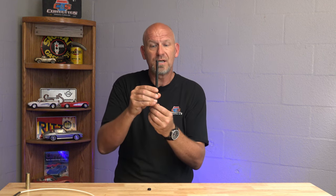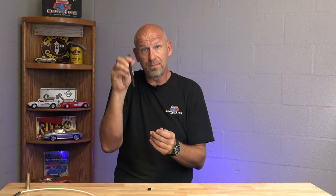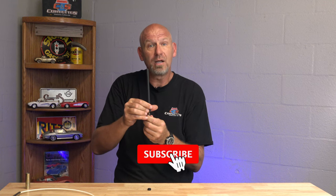And you're done. The last thing you have to do is you'll probably need to pull at least the right-hand most tail light to get in and unplug your antenna so it isn't constantly trying to run. Other than that, this is a one-and-done fix. And if you're going to go through the car wash, this just unscrews — you can put it in your glove box and run through with just the stubby. The moment you get out to wipe down your car, you can screw this right back on and you're good to go.